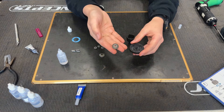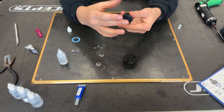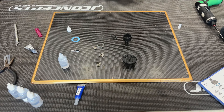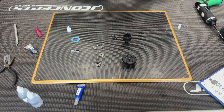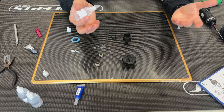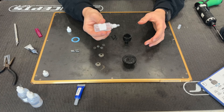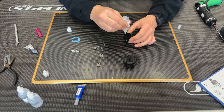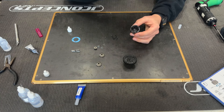I'm not going to put the sun gear on top just yet. While we're in this area without gears inside the differential, I'll go ahead and start filling it. For the center diff we're going with 5000wt oil — I'm basing this build off a Jared Wiggins baseline setup. I'll make a couple of changes as we go, but if you want to follow the manual to exact spec you can do that. I'll get a nice coating along the bottom.